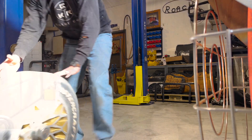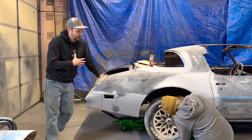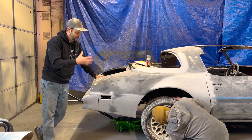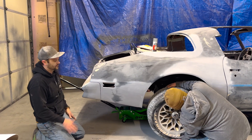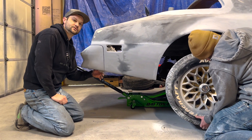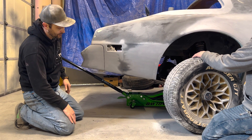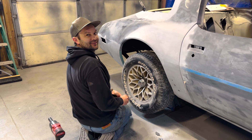Austin is putting on the tires because we've pretty much got the rough-in body work done. This is mostly ready for that initial high primer build. We've got the metal work done, the build parts done, and these bumpers — the back one needed more work than the front one, but you can see this body line is pretty nice. Had to do a little fiberglass building and work, and then once I got them where I wanted them, I reinforced the back with the body line we wanted, so when we pop these off this should stay pretty much how it was.